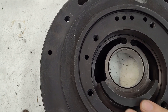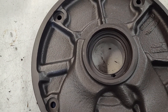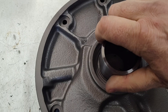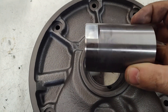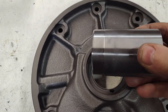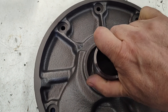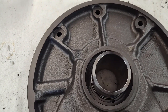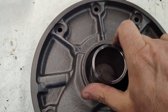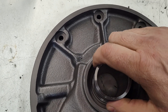I've just driven a new bushing in here. As I mentioned in another video, more often than not you have to size these. This is just a pump drive — a brand new pump drive. I build converters so I have a few of these around. You guys won't have this but you'll have it on the end of your converter, so you can just put your pump body over your torque converter and make sure you know what you're looking for. This goes in and it'll turn, but it's tight — it's got a lot of resistance to it.